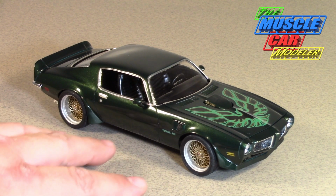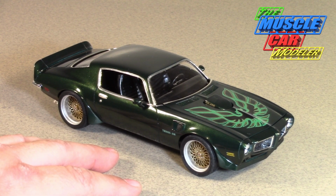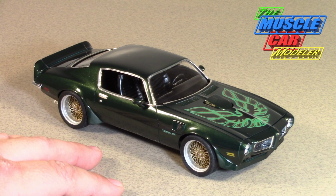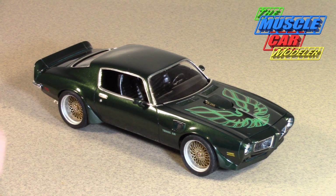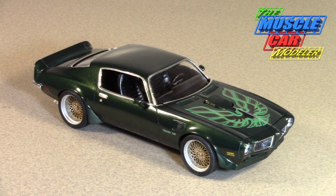And then the more modern suspension, keeping the traditional suspension as far as the unequal A-arms and the leaf springs, but front and rear sway bars a little bit bigger than stock. Urethane bushings, faster ratio steering box, and some of that stuff. And probably tubular upper and lower control arms, but not really going all out rack and pinion and full on race and tall spindles, that kind of stuff. But like the Wilwood or Baer brakes, and then that's how I would have it.